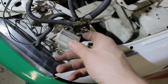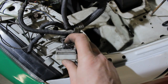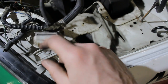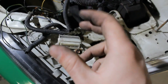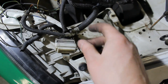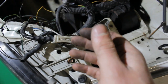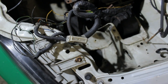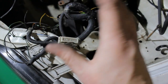I want you to take a good look at these connectors. Some might vary slightly, but they always have a lot of black wires coming out of them. This is a ground point and it needs to be bolted to the chassis somewhere — it doesn't really matter where, as long as it's bolted to the chassis. This is probably one of the most important things. The first time I did a wire tuck I forgot to do this, and I got lots of electrical issues — like the headlights turning on when I turned the blinker on. Just make sure you connect all the ground points.